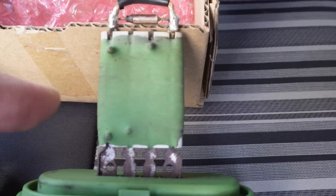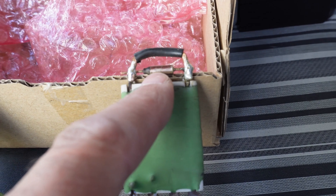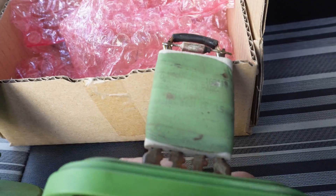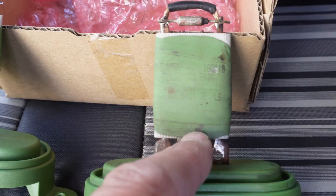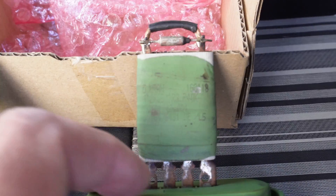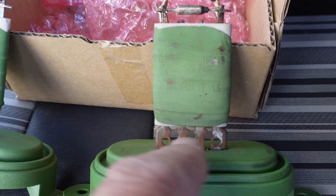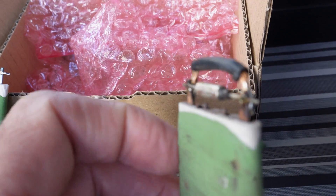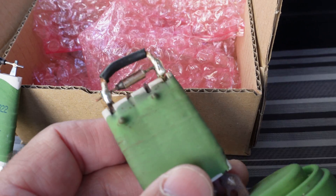I think these things just get very corroded very quickly. This is a 192 degrees centigrade thermal fuse — this thing is getting hot, probably 160–170 degrees. You can burn your fingers on it when you take it out if it's been used recently. So you've got this piece of metal constantly getting very hot then very cold — a lot of thermal cycling — and moisture in the van reacts with the bare metal heating and cooling. It's a very hostile environment for it really.